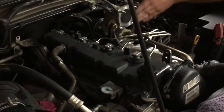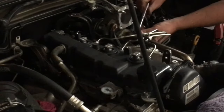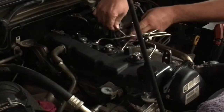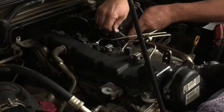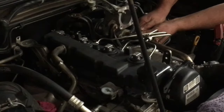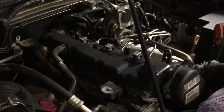And now that that's at the right height, because that's done first, then we'll nip these. And I think these are those sorts of things that are meant to be 13 newton meters. Again, for me, it's by hand. Remember, you're going into alloy, and I've probably done about 15 or 18 newton meters, right? Happy days. Look at that, getting back together.